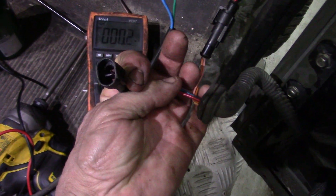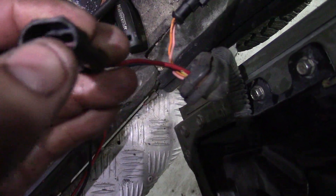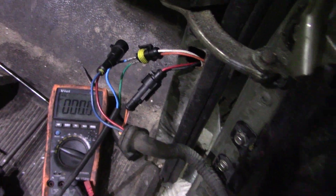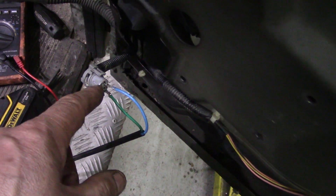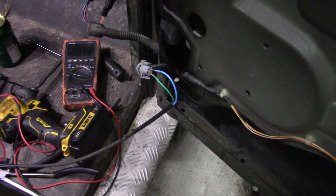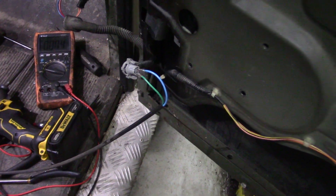I'm going to make another test lead - actually, wait, I think I can see the problem. Can you see that? The pin in here is either corroded away or pushed back. I've got a feeling it's pushed back, and if it has that's going to make our life more interesting. The pin had indeed pushed back, so I pushed them back in and want to make sure they're making a good connection. Testing the plug now - we're getting 12.13 volts out of it consistently.